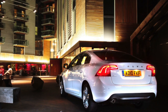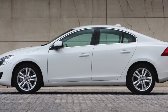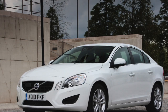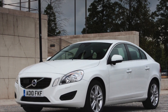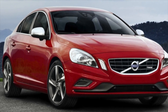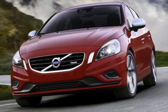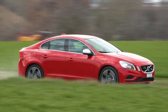The electrics of the Swedish sedan rarely fail — only minor troubles can spoil the owner's mood. For example, the door locks are delicate and last only 5-7 years. Keyless entry modules serve the same amount of time; at one fine moment they simply cease to recognize the owner of the car. There are also complaints about the rearview mirrors: over time the retainer breaks, after which when folded they turn outward. Additionally, the wiring going to the outside mirrors is not the best quality and quickly frays.